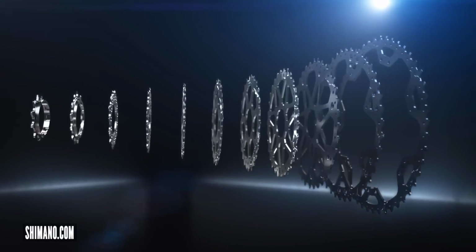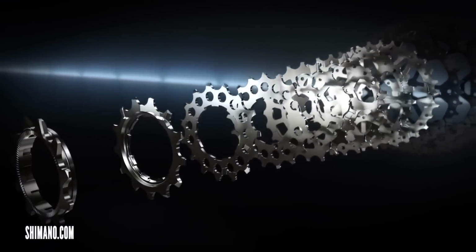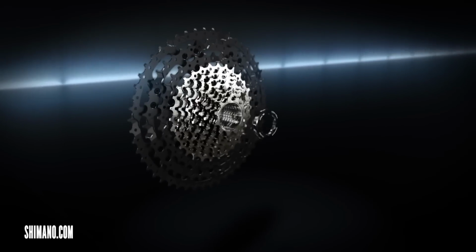Now, the big news when it comes to cassettes is the recent release of the Shimano Link Glide system. Now, this is slightly heavier than our usual Hyperglide system, but it is said to last 3 times as long, and it's going to be available in 10 and 11 speed setups, so you're going to be able to fit that to all of your bikes.